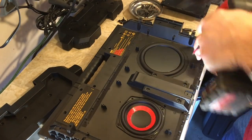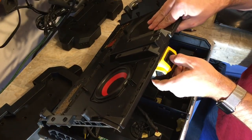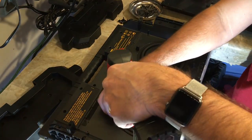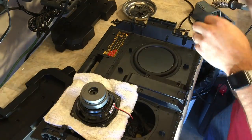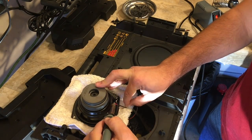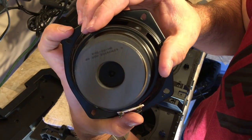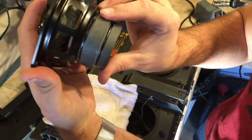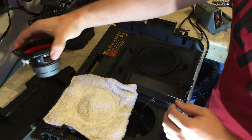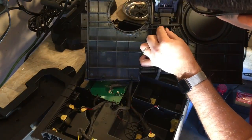As I'm taking these screws out I'm feeling around and realizing there's a gasket on the edge with screws under that as well. I should have taken the battery out before I started, but I didn't realize it was still in there. Now I'm realizing that the speakers are soldered on. I'm not going to be mad about that — it means it's not going to come loose. It looks like it's a pulp-injected speaker cone. I thought maybe it was Kevlar at first, but looking at the back you can see the pulp. It's a nice woofer that holds in there tight. And on the backside there's one more connection — that's where the battery connects.